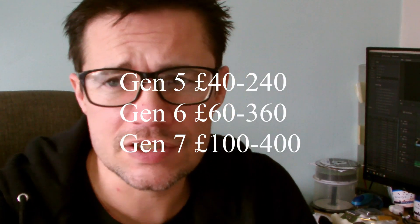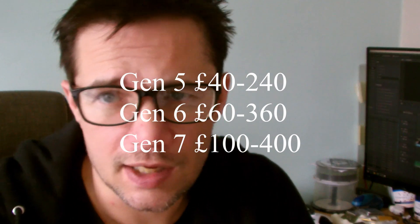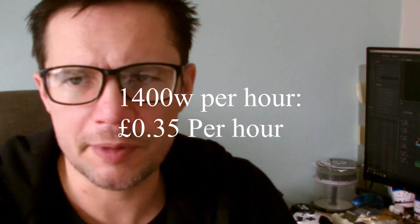The quick question is: would I recommend a Gen 5? The answer is probably no. The backplane and drive speeds are going to be slower, the processor is slower, the motherboard is generally slower and more power hungry. Even in a lab environment, the G5 is relatively cheap — you can pick them up for a pittance — but a Gen 6 is a better option and a Gen 7 a better option again. If I had the Gen 5 running at full speed, I'm going to use quite a lot of power and not get maximum performance.